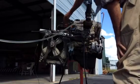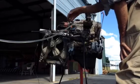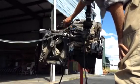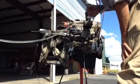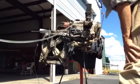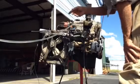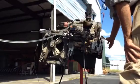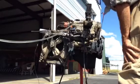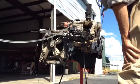And I took this little rotor thing. I figured it had too big a gap because we could get fire everywhere except between the rotor and these three pins here. So I hammered it and made it where it's a little closer to the pins, and I could rig up my spark plug tester to the wire and turn the crankshaft, and we get sparks going to each plug that way. But it still wasn't enough to make it run.